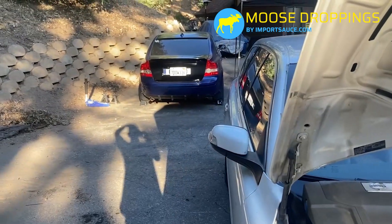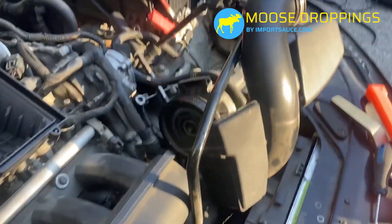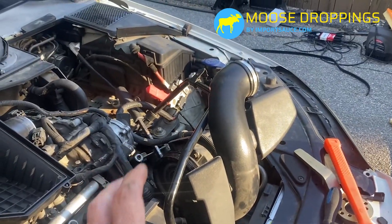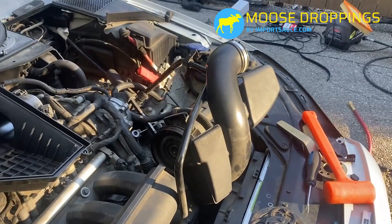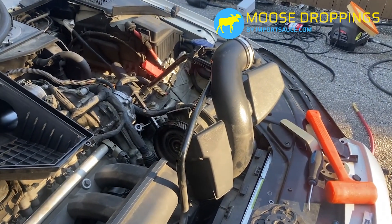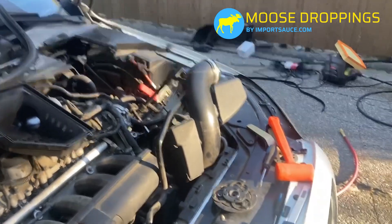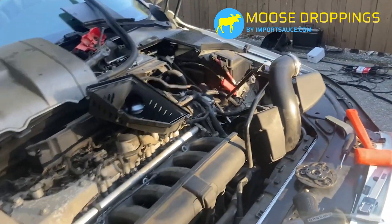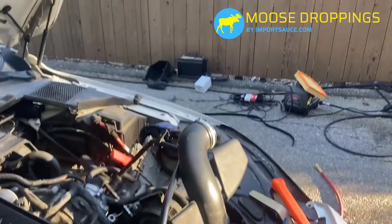We did that on the S40 years ago — just pulled some shims out and it has worked beautifully ever since. On this one it looks a little rough, so we're going to try this and hopefully be okay. If not, we'll be looking at ordering the whole kit. The problem with this version of the car is there's no reliable aftermarket option — there's one kit on eBay for about $100 from Germany, no-name brand. The genuine Volvo kit is only $250, which isn't terrible. If you can do this yourself, $250 and half a day's worth of work is better than paying the dealer probably $1,000 plus parts. Hopefully that helps and gives you an understanding of shimming the AC electromagnetic clutch on Volvos.